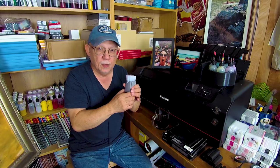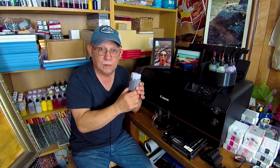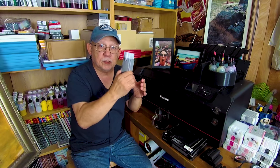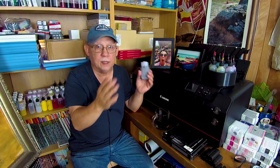The mistake people make is loading 80 ml of ink when they shouldn't. When you buy the loads from Precision Colors, you get 82 ml — you can squeeze in that extra 2 ml. But you can't do that if you still have 18 ml of ink in there, because you are loading ink using a totally different procedure — vacuum filling or pressure filling — which you can check out in my previous Pro 1000 videos. This procedure only works if your cartridge is empty. Load 80 ml in your 100 ml syringe, then do your pressure filling or vacuum filling. I demonstrated all those methods in previous videos, but you have to have an empty cartridge.